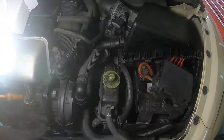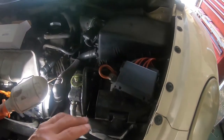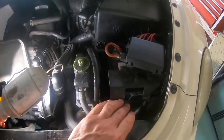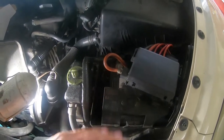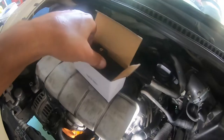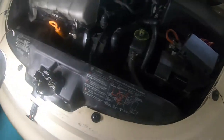Hopefully this will be one cool takeaway from this video. The way that every place I see does it is they remove the fuse box on top of the battery, you pull the battery, you pull the air box, you pull the battery panel, and there's a plate that the battery box sits on. You pull that plate out and it reveals two 10-millimeter bolts on top of the unit and the unit drops down. And once it's dropped down, then you fiddle with the connectors, which are kind of tricky because they are watertight connectors.